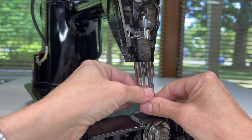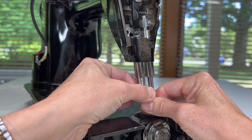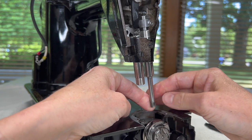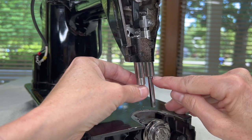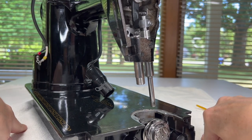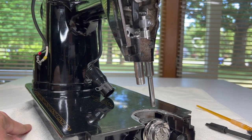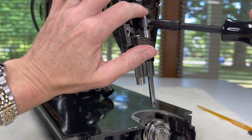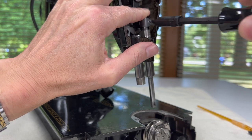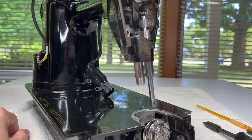I have the needle bar lined up and I can still see my second line right at the bottom of the bushing — it hasn't disappeared but it's literally right at the bottom. Now I can take my screwdriver and go ahead and tighten this down. I don't want to lose that position at all. It's been installed — you should have your needle bar centered and set at the right height.